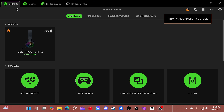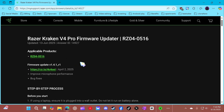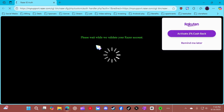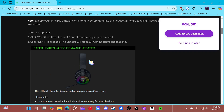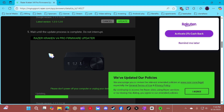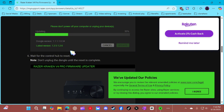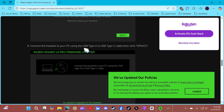I have the wire here. I'm going to hit firmware update — it's going to say firmware update, we're going to hit firmware update. It's going to say view online. Hit view online. Razer Pro update — hit run the update, hit next. Wait until it's done, do not interrupt, do not unplug the dongle until it's reset. Resetting the dongle.